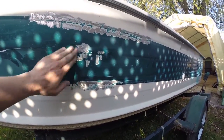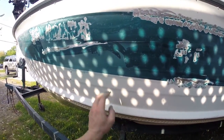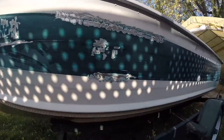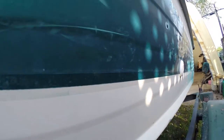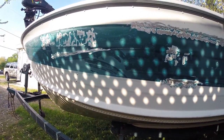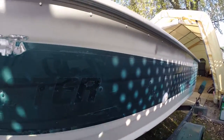I've taken off all the old vinyl stickers and ground down some of the areas with an angle grinder with a polishing pad, and I just need to get all the dust off and remove any sticky residue left behind. Most of it's pretty good. For any area where I can see metal, I've ground it down just to give it a smoother finish — done that on both sides. I'm going to wash it with soap and water and see what adhesive is left to take off.